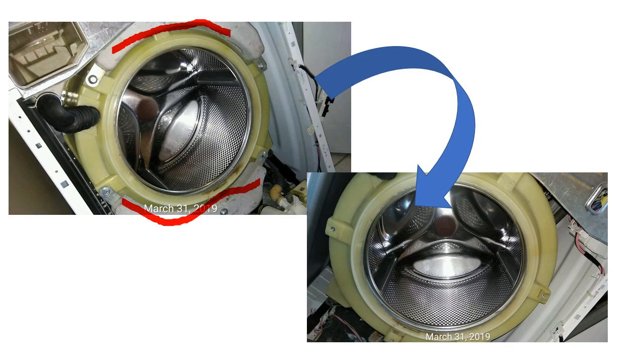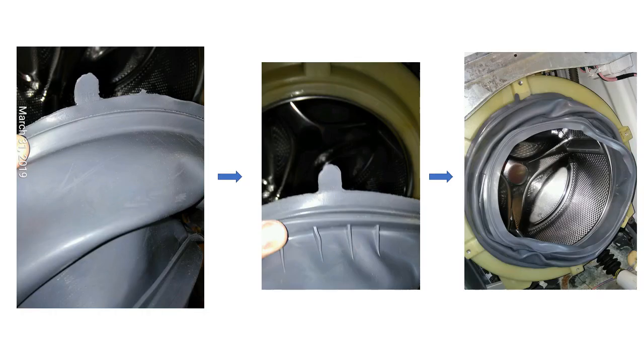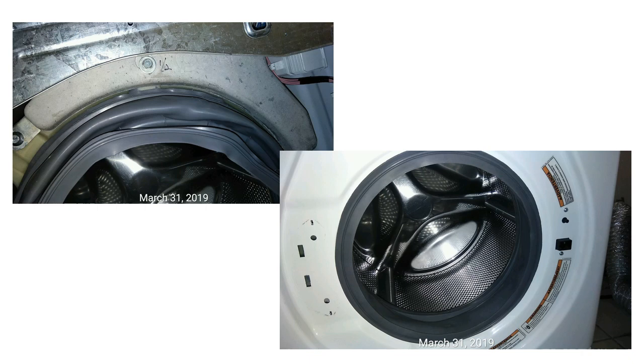This is how your washer looks now. Let's put the seal back. The seal will have a mark saying 'up' and on the bottom 'down', so you need to put the upside on top and the downside on the bottom. Align the upside right in the middle of the tank and try to put the seal on snugly. At the beginning it may be a little difficult but it gets easier. Once it fits snugly, put the tensioner on — the one with the screw — and tighten it. Then put the two concrete blocks back.